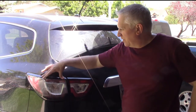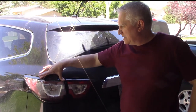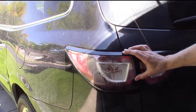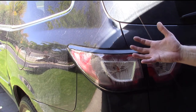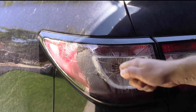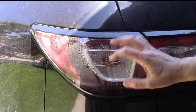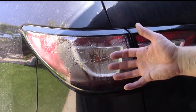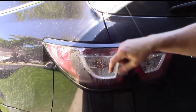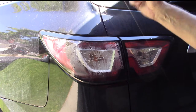The reason they're bad is that when they designed these taillights, both sides driver and passenger, they end up not staying sealed. You can see here we've got all this condensation that has come inside of the taillight. Compounding that, somebody came along and smacked it to try to get the droplets to go together, and it ended up shattering. The other side actually has the lens broken and come off, which means you can't wash the car. Water will get in, get to those taillight bulbs, and then you'll have a short, blow a fuse. So today we're going to repair those.